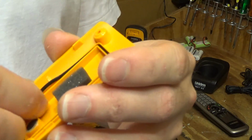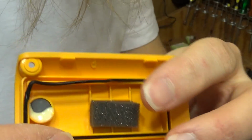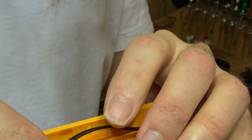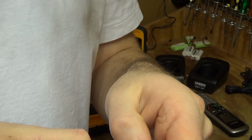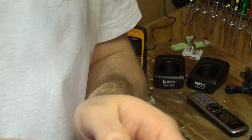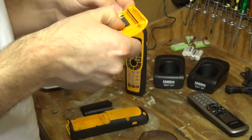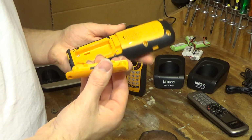this gasket was not installed correctly, because you can see there's two marks, whereas if it would have been pinched like that almost. And I don't think these batteries have ever been replaced, so that means that is a manufacturing defect. And if this were to actually get wet like that, probably would have had some problems.